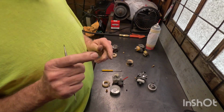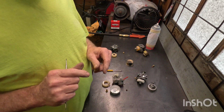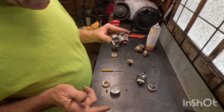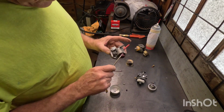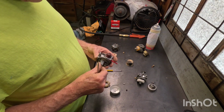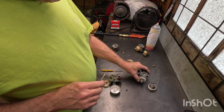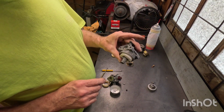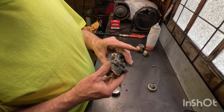Now, if I clean a carburetor and it still runs crappy or won't start, I go get another carburetor. Tecumsehs are getting, like I said yesterday, they went out of business. You may end up buying an aftermarket carburetor, which is okay, but beware that sometimes the aftermarket carburetors do not run correctly, especially the Chinese stuff. Now the Oregons, I've had pretty good luck with those. Honda carburetors are cheap enough. I would not hesitate to buy a Honda carburetor. They're generally anywhere from $35 to $50, $60.